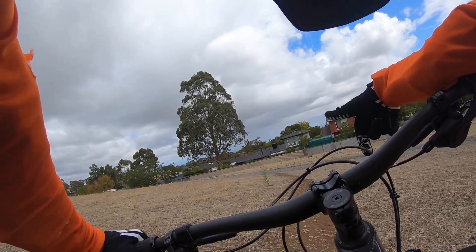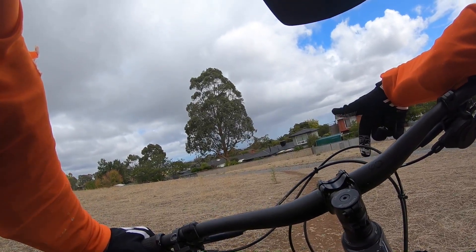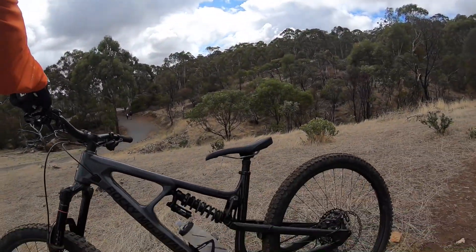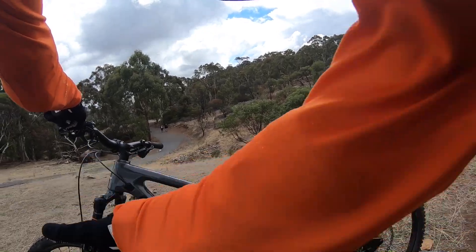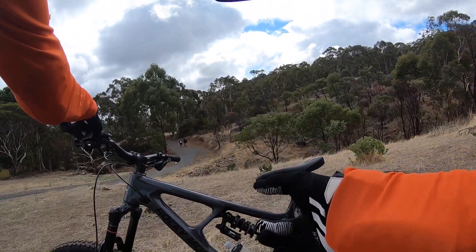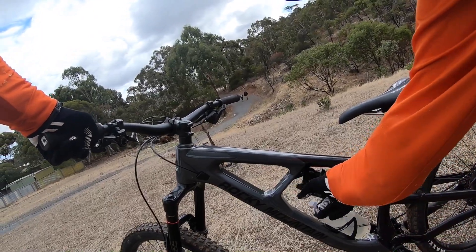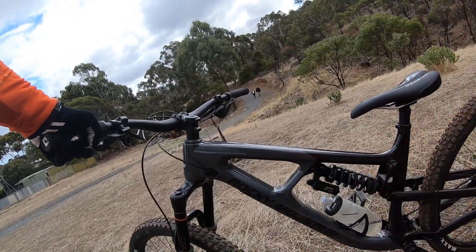This thing feels capable, but it's not set up right. I'd like a softer spring in the back. I'm going to mess with the front now, but yeah, that back spring — I'd need a 350 which I just grabbed off a friend, but it's too long. It doesn't actually fit in there; it's a longer stroke version.